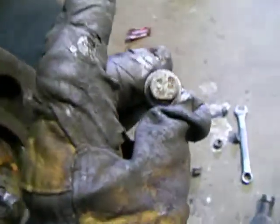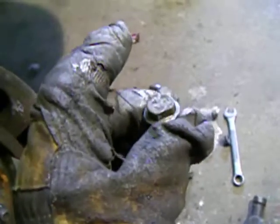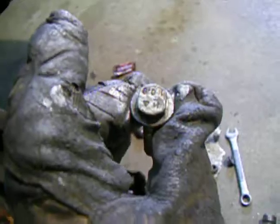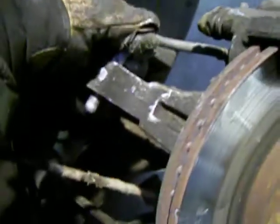Second thing is, there are these bolts that do not have a hex head on them, so you're not going to get a box end wrench. They're not intended for that. There are only two parallel surfaces there. The rest of it's all round. These go in the top of the knuckle here where the strut goes in. There are two of them. So basically, I don't know if you can see right there, but on this part of the bolt, there are teeth that bite into this surface.